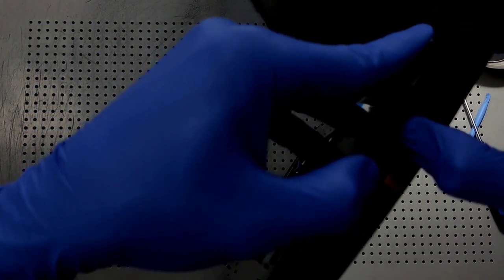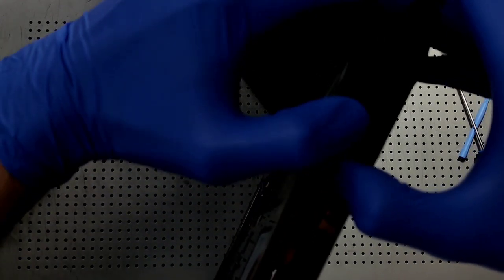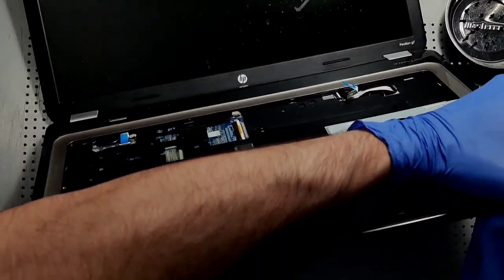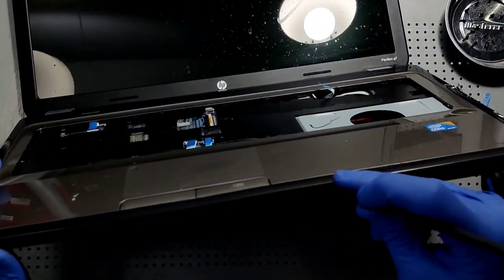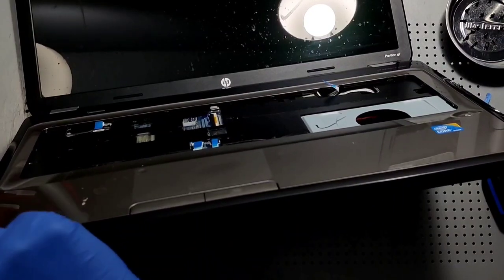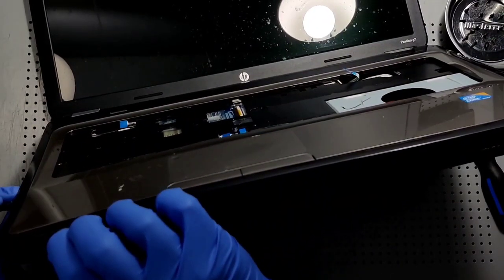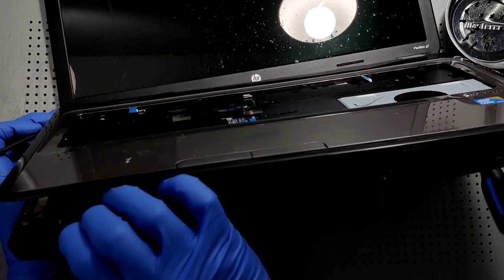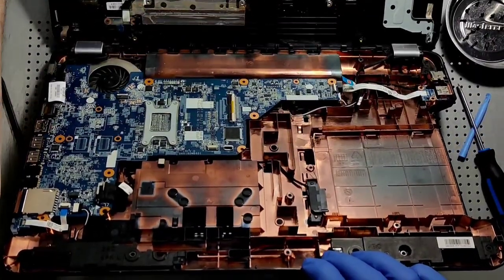As you can see, that was just a quick clip. So now because it clips so easily, and because I'm putting pressure in the right spots, I can just follow that along. You want to use a pry tool to make sure you're releasing all the clips without breaking any of them, so that when you put the computer back together it still has that strong ability to hold the bezel on. Just work your way through and it pops right off.